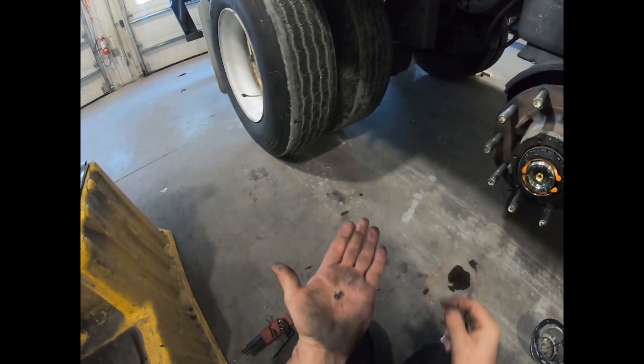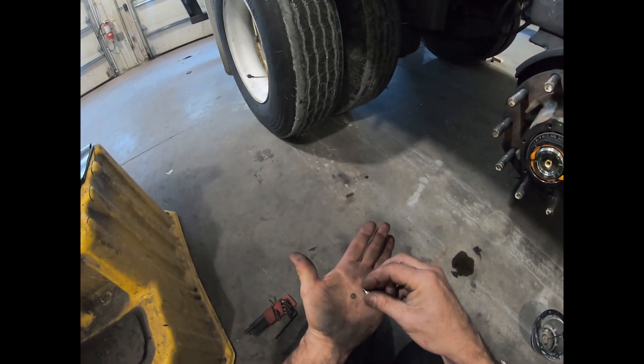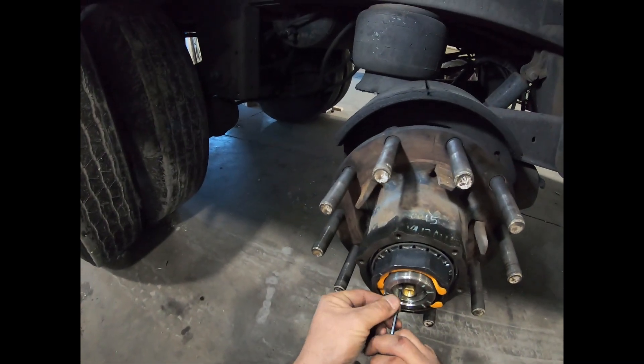This produces an audible air leak at the overheated wheel end and causes the auto inflation indicator light at the front of the trailer to light up, which serves as an audible and visual warning to the driver to have the wheel end checked out.